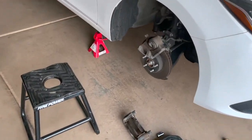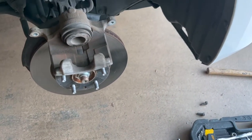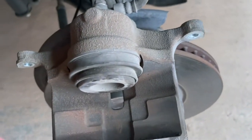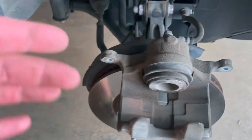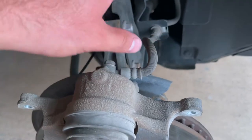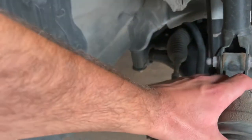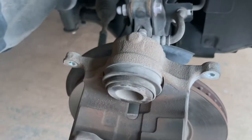I just had to cut in here for a little bit. We've got the wheel off and the brake caliper off as well. Here is where the brake pads are housed, here's the rotor, and here is the piston side of the caliper. When you take this off, you can undo this clip back here and just hang the caliper up so there's no tension on the brake line — but there's really not too much tension on it and they're pretty sturdy, so I'm not worried about it at all.